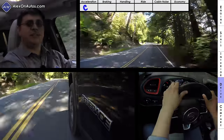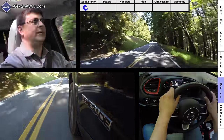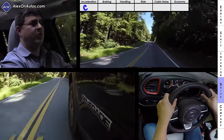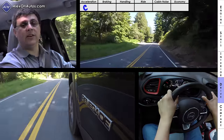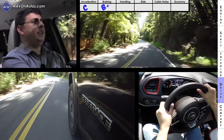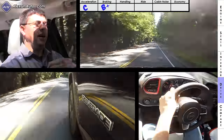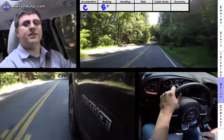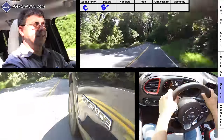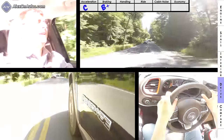When it comes to acceleration, we ran zero to 60 in eight and a half seconds, even though this has one of the more powerful engines in the segment and a nine-speed automatic. The reason is likely the curb weight — depending on configuration, the Renegade can approach nearly 3,500 pounds, comparable to a V6 mid-sized sedan. For braking, our Limited trim ran from 60 to 0 in 118 feet; other trims can expand to 120–125 feet, with the Trailhawk's figures influenced by curb weight and tire size.